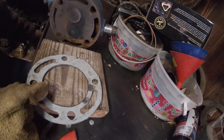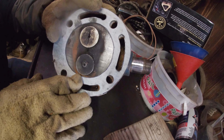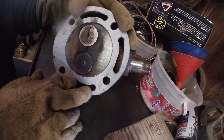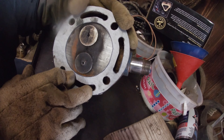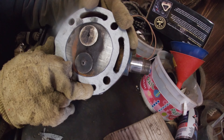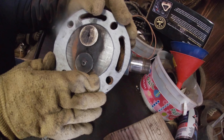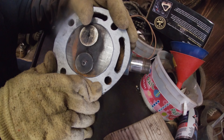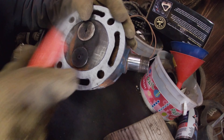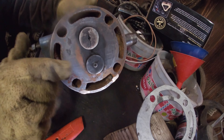We'll now lay it on there and make sure we've got something that's going to work — we didn't screw this up royally, which has happened before. It looks like we have all four bolt holes and our three water passages, and we still have enough meat to seal on the head. I'll probably use a little bit of number two Permatex on this — just a thin film. That stuff seems to seal up leaks better than just regular silicone. We might even polish up some valves, but the head was in pretty good shape. The only thing wrong was the busted piece.